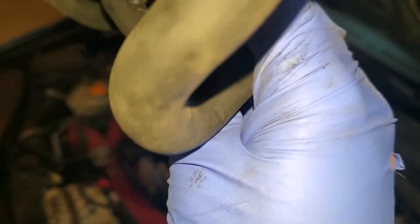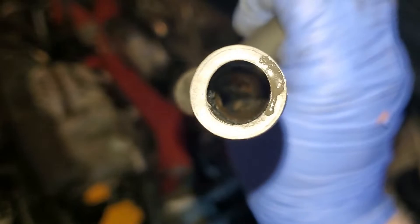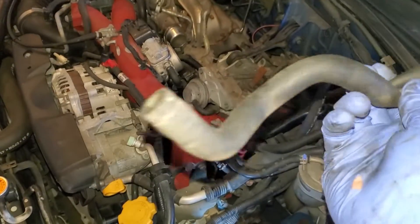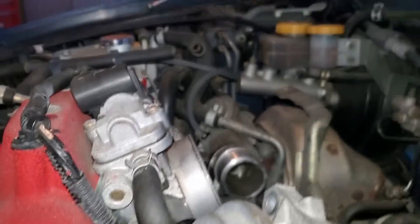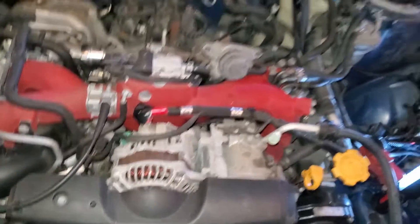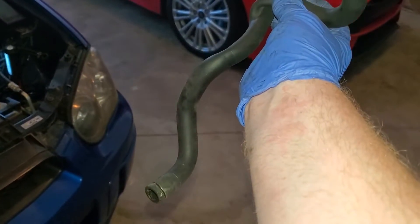When I took this off you can see the water droplets. This is the hose — it's causing all that crap. All the condensation in my PCV system is coming from this. You can see the other two hoses — well, this one's clean, but this one looks like it has a little condensation going in too. That's probably because these two are directly connected through that pipe.